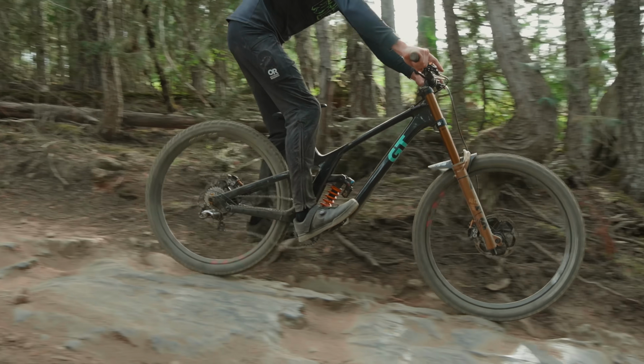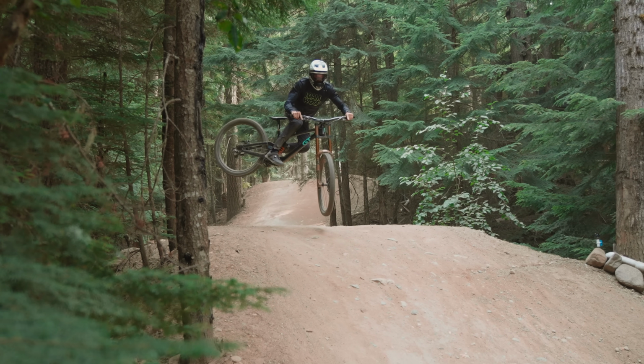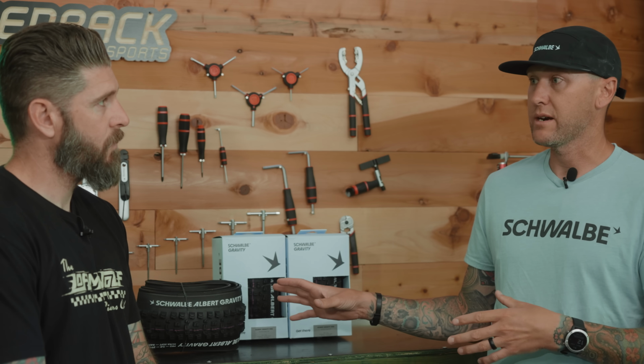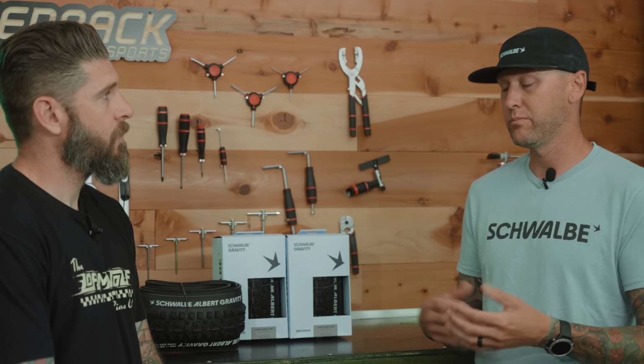And so that eliminates a couple 100 grams per wheel. It protects your rims, but also offers better performance in that contact patch. So it gives you more adjustability in your actual tire pressure. So you can tune your tire pressure rather than having to deal with your suspension or putting inserts and other things in.